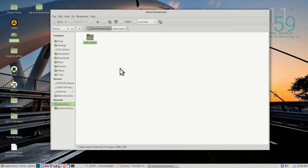First thing I had to do was go ahead and change permissions, which was really not mentioned in the how-to on this. It just says basically set it up and do this. I set this up as a Windows share, mainly because a Windows share can be accessed by Unix systems, Linux systems, Mac systems, and of course Windows. It's Samba is what it is, but they call it CIFS now.